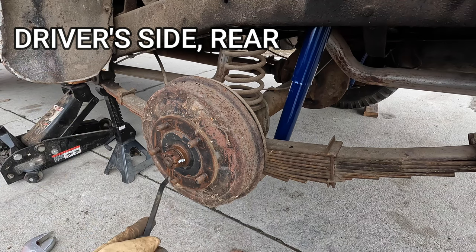These pads look just like the ones in the front — a lot of meat left on them on both sides and the surface of the pads look pretty good too. There's no damage that I can see. Everything looks usual and customary in here and I think these brakes were in fact done at the same time as the fronts. We've got a lot more spider activity in these for some reason. I'll get this cleaned up and then we'll just put the drum back on — I don't think we have to do anything.